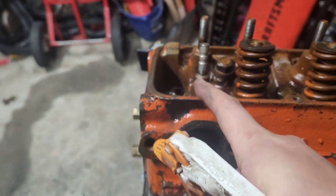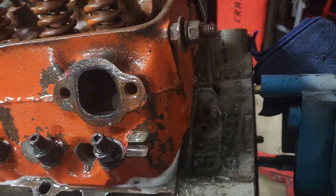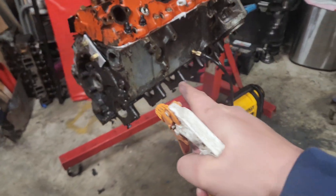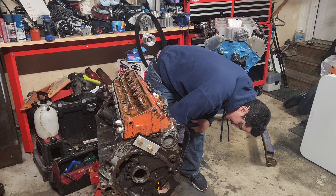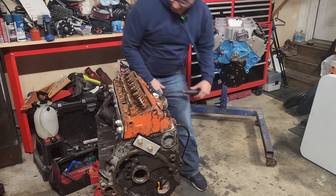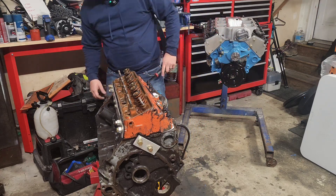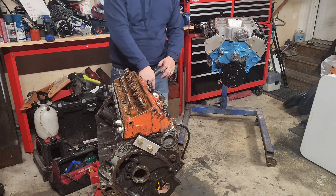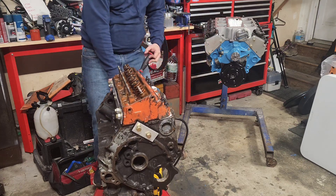This one here is hanging a little open — you can see there's no spring there, so it's not going to hold anything. Overall, nothing concerning so far. I'm going to go ahead and flip it over and we're going to spray inside the cylinders and check for cracks in the water jackets. It is still holding pressure — we're still holding 15.3, 15.2. That's really good. If it was leaking pretty bad, it would have already leaked out and that little compressor would have turned back on. You don't need a fancy compressor — if you have a bike pump, that'll work just fine because it has a little gauge on it and you just put air in there. It's that easy.